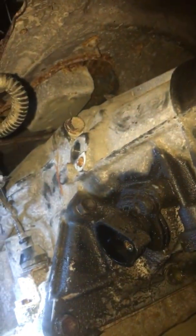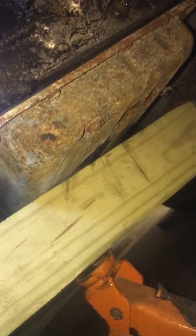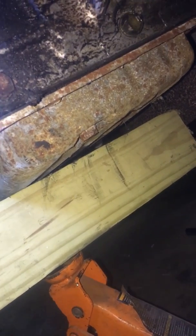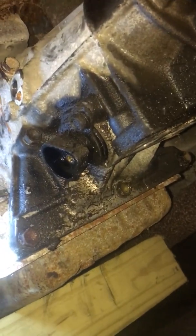There are two more bolts on the other side up top. I don't see anything additional up there. There's another bolt right there at the top. Once you get this out, I've got just a 4x4 supporting the transmission — otherwise the transmission is going to sag and you could damage your motor mounts. Do not just let the transmission sag.